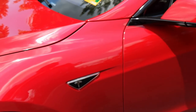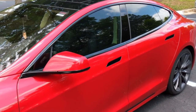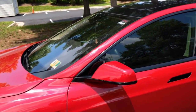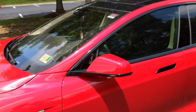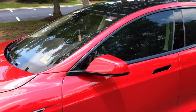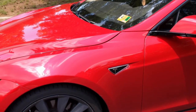Take your fingernail and run it in the edge to get it down there so you can see exactly where it is, then take your knife and cut it out. A few general tips for cutting vinyl: hit it with heat first before you cut with the knife. Hitting it with heat releases the tension so you don't get any pullback — and don't cut while it's still hot. Wrap it, hit it with heat, let it sit until it cools down, then cut. That'll prevent any kind of tension or pullback and keep it nice and sharp.